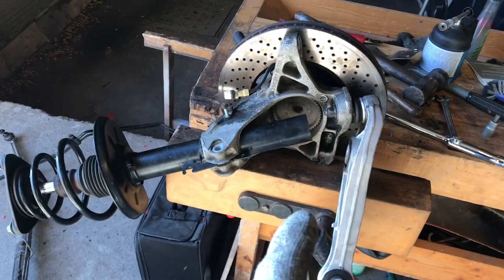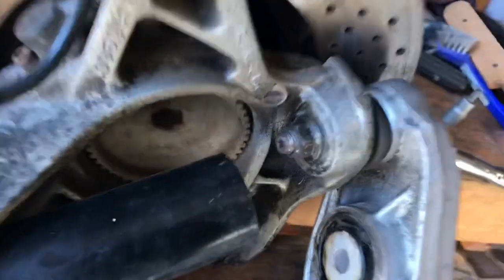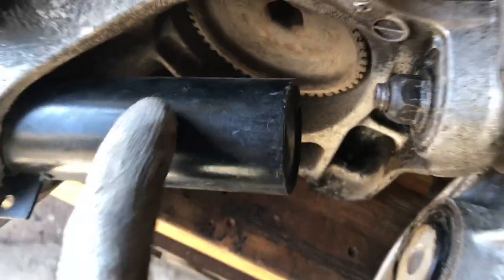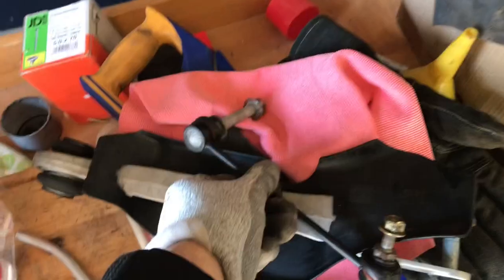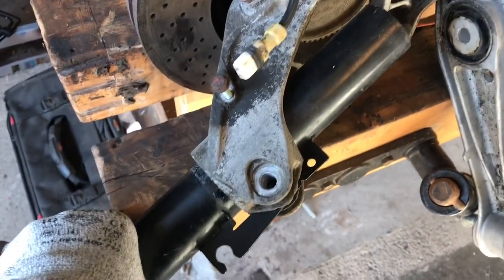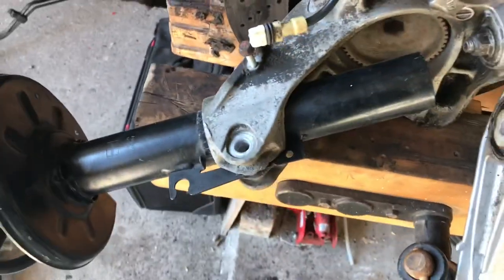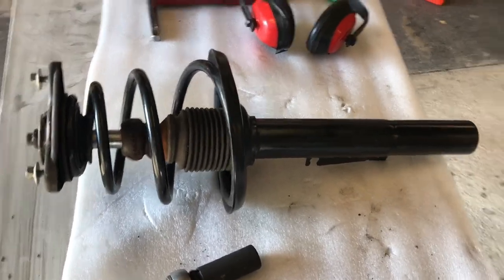The tuning fork is off, but the coffin arm is still on — it's quite difficult to get in there given the distance between the strut and the wheel carrier. I've taken off the drop link, which I'm thinking about replacing anyway, and then carefully slid the strut out — blowing it with air first so I didn't scratch anything. The strut came out pretty easily.